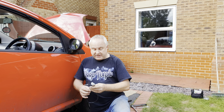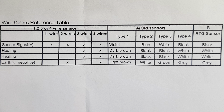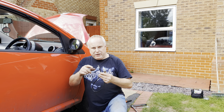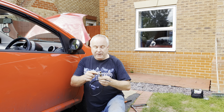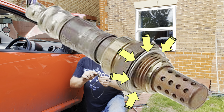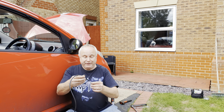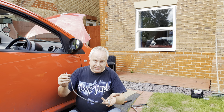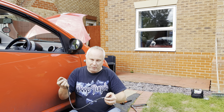If you're fitting a new O2 sensor and it's a universal one that comes with no connector on the end, it should come with the necessary hardware for joining the leads to the existing car's connector and wiring instructions for which colour goes to which. Do not solder the wire joint — use crimps. There is a special tool for crimping these together, but if you haven't got one use the cutter blade in a pair of pliers; don't go mad because you don't want to cut through the joint. If you do reuse the original sensor, put a little exhaust assembly paste just around the washer — not too far up the threads — so that when you tighten it down it makes a gas-tight seal, because these are crush washers and it's already been crushed once. Don't forget to keep the heat protection sleeve on the wires. When cutting the wires shorter, cut the wires on the new sensor rather than the wires from the connector, so you can always reconnect back to an original O2 sensor if needed.